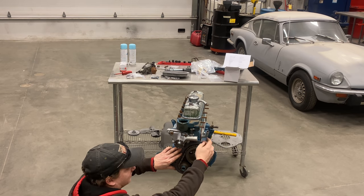While I'm waiting on the front cover, I'm going to put the old spark plugs back in. Again, I'm doing that just for painting purposes — that way I don't have to mask this off. I can just paint those old spark plugs and then take them out and throw them away. This spark plug is going in a bit tight, so I'm going to take this to the wire wheel and then try it again. I want to make sure that it's the threads on the spark plug and not the threads in the head before I go any further. The threads are all cleaned up — let's give this a go again. It looks like it was the threads on the spark plug, so everything is fine.